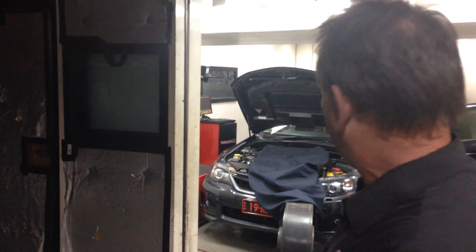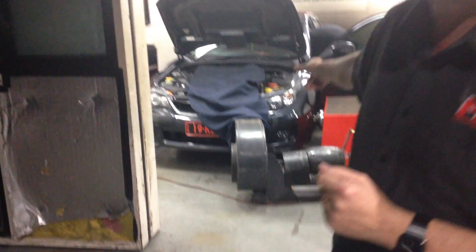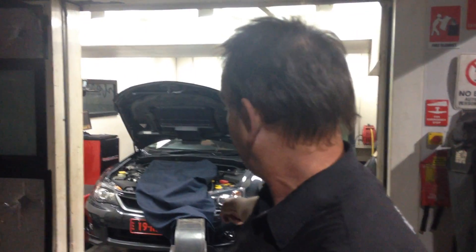If you're wondering what the blower is at the front, this is why our tunes are so consistent on our dyno. The whole dyno cell, when it's running normally, evacuates the room with the airflow, but that pump there delivers cold air directly to the top of the intercooler. Because with a normal front mount blower on a normal dyno, you can't get enough air through the top mount intercooler to get consistent power runs — you'll always get an unreliable tune, or never as good as what you possibly could. So that's a little tip if you're choosing where and how to get your car tuned.